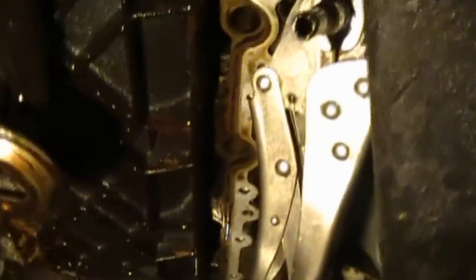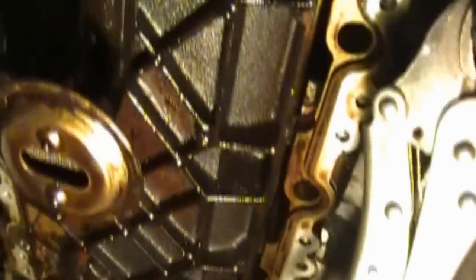One thing I wanted to show you - I got the dipstick out of the oil pan. There's one bolt on the dipstick up here that bolts to one of the brackets I took off. I went ahead and took the oil pan off and it was real easy. I just loosened all the bolts and loosened the motor mount just in case, but I didn't actually need to. There's the oil pan. The bottom of the motor looks actually pretty clean - no problems. There's the oil sump. I'm going to take that off, clean it, and put it back. I do hear that sometimes they get plugged up.